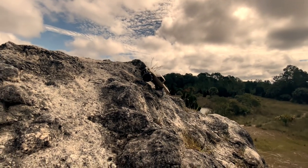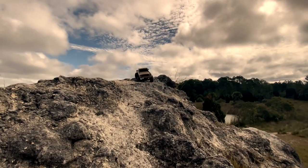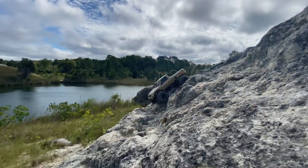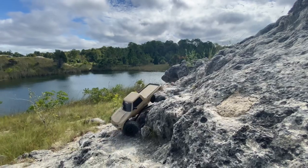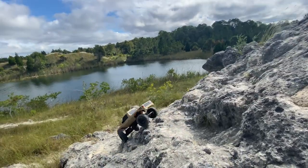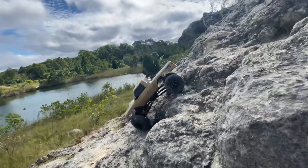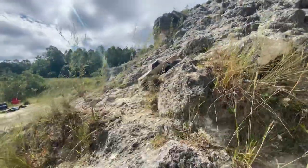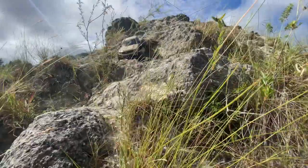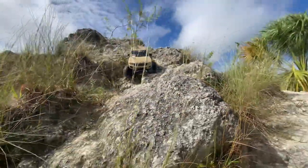The very last thing I did was swap out the cage body it came with for a Traxxas TRX4 Sport body — of course had to do some trimming. Right now the body is kind of what stops the wheels from flexing. Without it, those wheels would flex a lot more with the suspension. Too much flex raises your center of gravity, especially with my tires weighted — that one tire way up in the air throws that weight up. So side-hilling with too much flex is, in my opinion, not good.